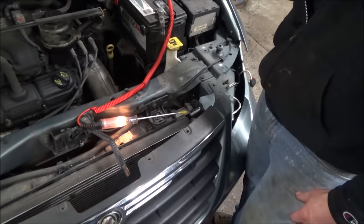Just for the sake of experiment, start it up again, Hannah. With no AC there's no command for control. Turn the AC and everything back on. Okay, they just commanded the fan on — that's conclusive. It's a little bit dim there, but you can see it's starting to get brighter and brighter. Now if we put a scope on there, you'd see that duty cycle — it's probably up at 100% right now.